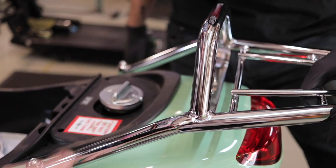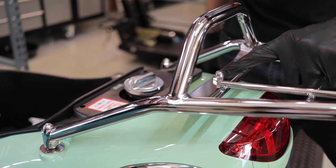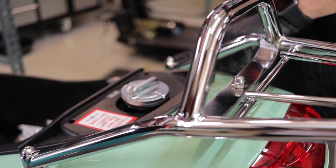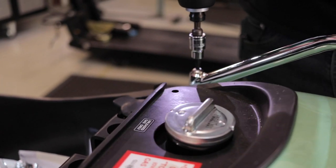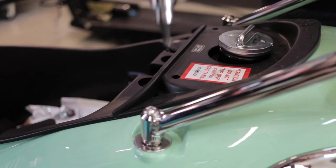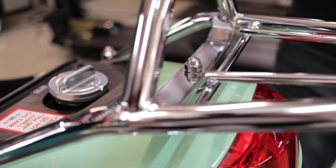On your hardware here — what size is the hex key and the lock nut? When I removed the original rack, this is a 12 nut, and when you install this new one it's actually a 13 hexagon tightening nut, and your Allen keys are going to be a 5. It doesn't take a whole lot of pressure — just a couple of clicks with the gun. Tighten it right down; you don't have to over-torque, just make sure it's nice and secure. If you're the type that doesn't have restraint on an impact gun, hand tools are definitely going to be your friend. Don't be afraid to use hand tools — it's really all you need, but if you've got a gentle touch on the power tools you can use them carefully.